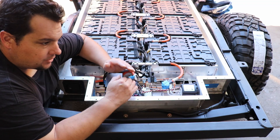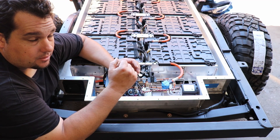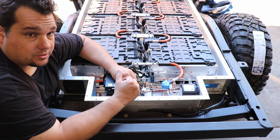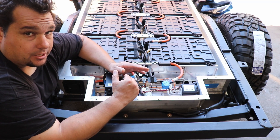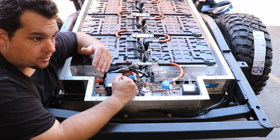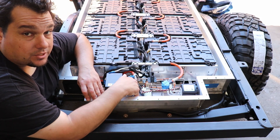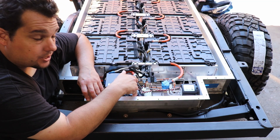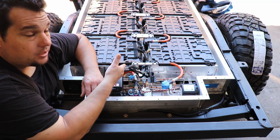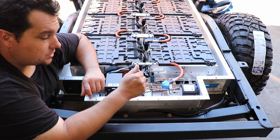Basically it's a way it saves itself and prolongs the life of the contactor. Otherwise, if it just latches and holds with all that amperage, it eventually burns out. There's also another variant — the PA — which is externally economized, just a contactor without any logic. Some systems require that because the motor controller itself handles latching and backing off the coil amperage. The GV200MAs can take up to 1,000 amps, whereas the stock contactors take about 400 amps, and this motor takes a little over 700 amps at full throttle.